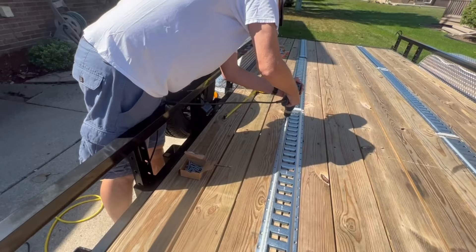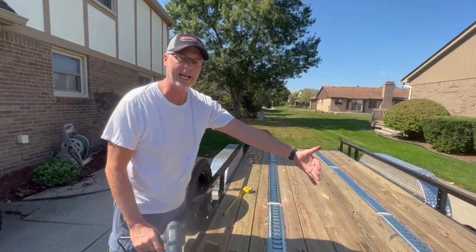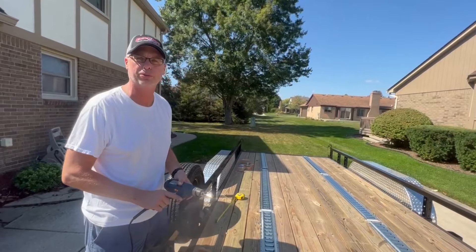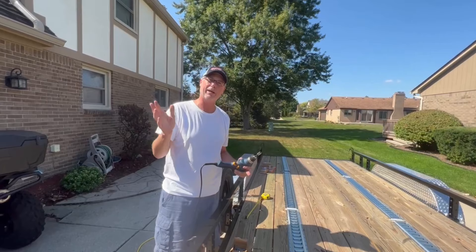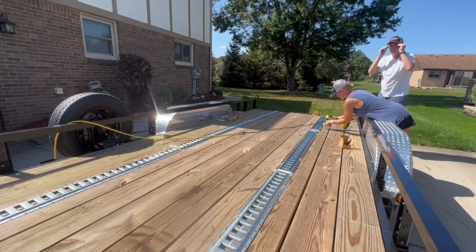Where did you measure it from to make sure it was consistent? I measured from the steel in, centered my tires on these two runners coming up so we knew right where to pull it, and then I centered that on the trailer. That way we try to have the same amount of space on each side and the weight on the trailer is really well balanced — so we can also take kayaks, camping equipment, and all kinds of other fun stuff. Since my tires aren't the same width as yours, we split the difference. We had two different quads with different tires — the same quads basically, but different tire sets making the center of each wheel about three inches different. So we took about an inch and a half, split the difference, and it absolutely still works fine. We're going to run it down so we can pull both quads straight up onto the e-tracks in either order.